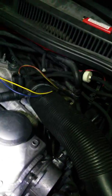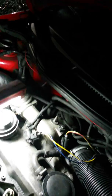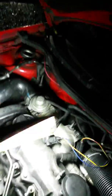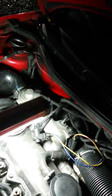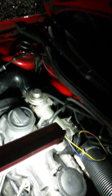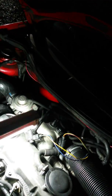So what's happened is there was a short to this solenoid, which normally is mounted behind your intake — which is stupid, I know — because it's on the motor and it's doing this all day long. This has been bugging me for a long time! Because the motor is shaking so much, because it's idling rough, the wires are chafed, which makes it worse. Your wires wind up going to hell, and in this case it idled so bad it broke the mount for this solenoid.